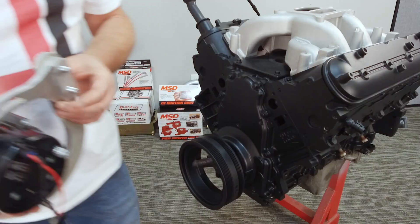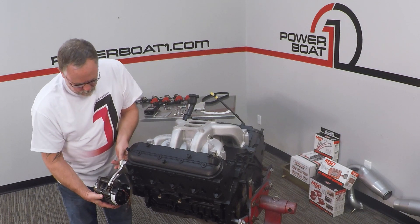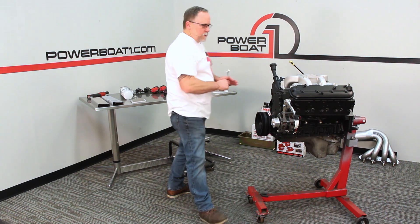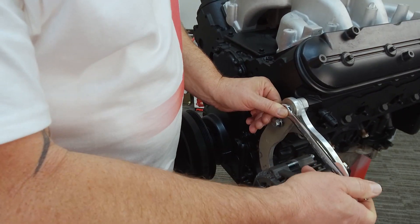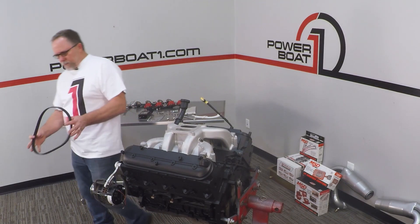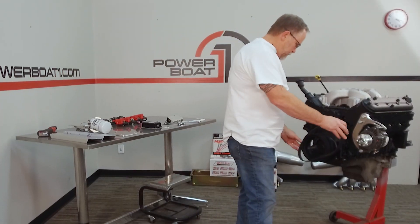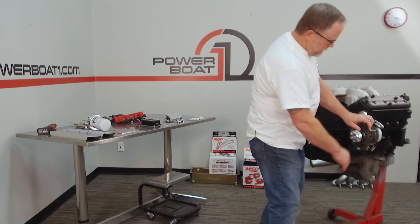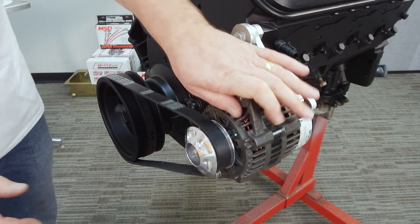This little piece here is just going to bolt right to the head — nice and simple. The belt I'm going to use on this is a 42 inch belt and we're going to run off the front six rib on the factory serpentine kit. That way you don't have to build anything else, so really that belt will just go on, there's your adjustment there and that'll be good and tight.